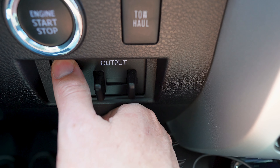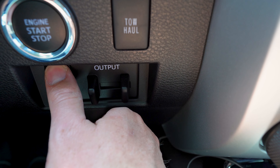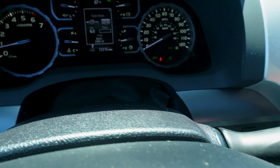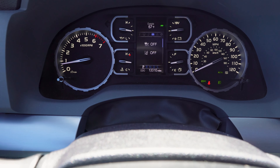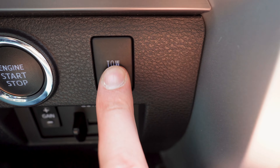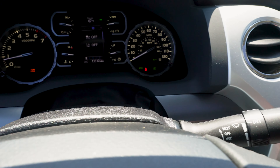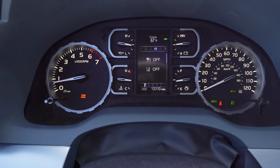Set that, make sure it's correct, and then exit right back out. Then you want to come down to your trailer brake controller — on the Tundra it's right here. When you start moving, you just want to manually hit your trailer brakes like that, make sure it slows down your truck and that it's good. You can also adjust your gain right here. On this vehicle I have it set to around 6, which works well for this particular trailer, but you'll want to adjust that to your particular vehicle. You can see it has adjusted to 6 and then just pops back over to the main screen.